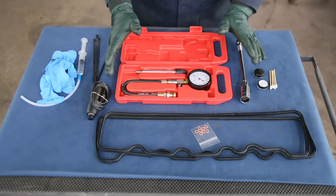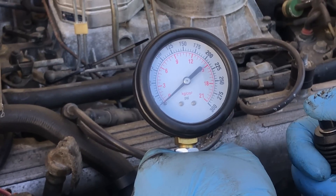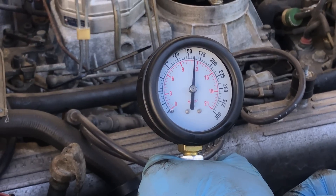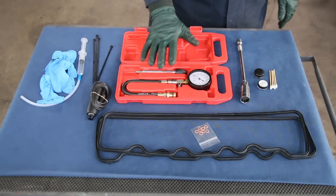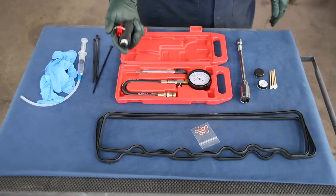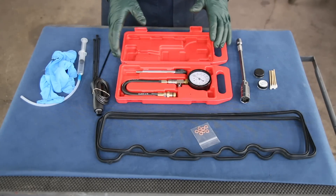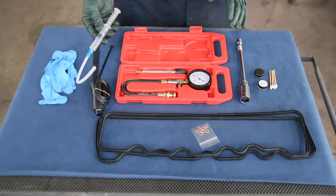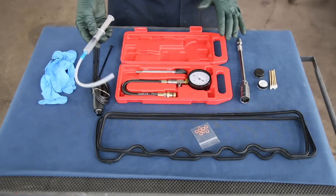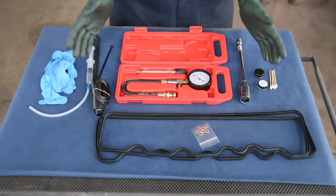As for cylinder wall and piston ring wear, you're going to do a compression test. I've said this over and over again — particularly with the diesels — when you get one of these old cars, do the compression test right away. That's your best indicator of how healthy the engine is. So I include a good high-quality compression gauge, a remote starter switch for those who want to use one, and a syringe that will allow you to do a wet compression test on a particular cylinder if you find a weak one during your testing procedure.